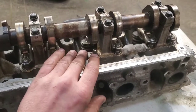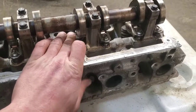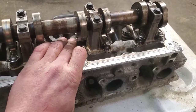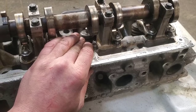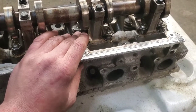Didn't understand right then why we had low compression, because even though this intake valve wasn't opening at all - it's staying closed, not letting any air in - you should still have some compression. But we had nothing.